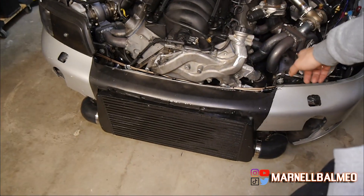I've addressed the oil feed, I've addressed the PCV — the last thing really to look at is the oil drain. It should be okay because I went with 12 AN for the drain, but it is a pretty long run from the turbo all the way back to the oil pan, so maybe there's some improvement I can make there. And then I think that should be it — thanks for watching and I'll see you guys next time.